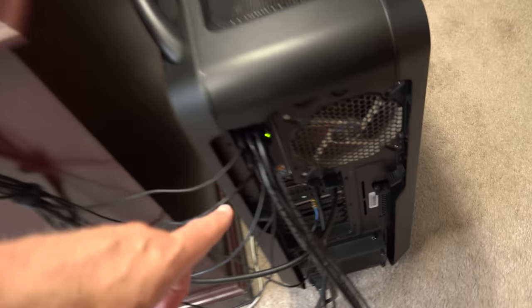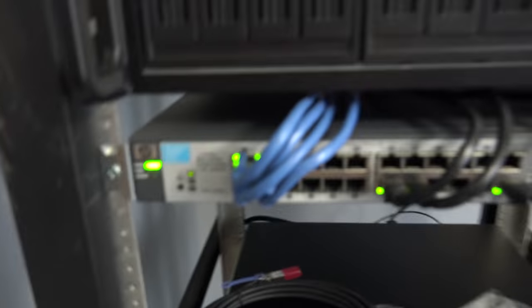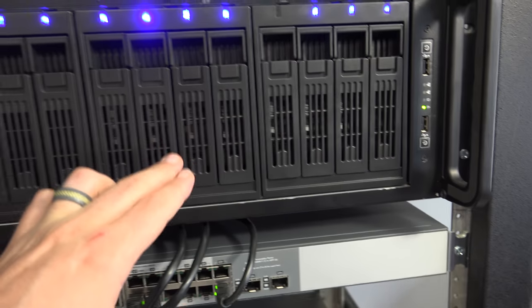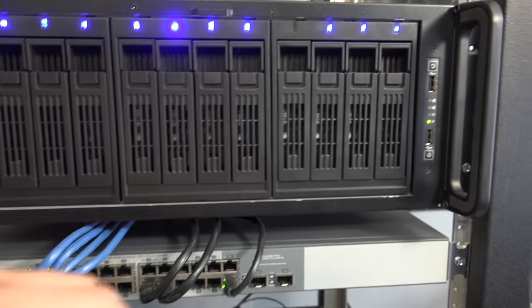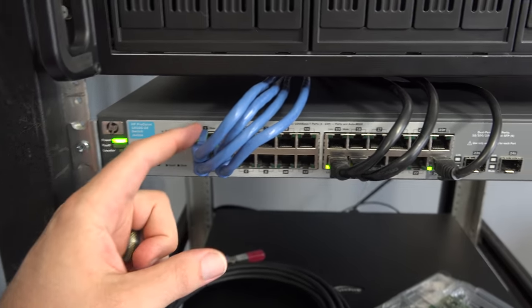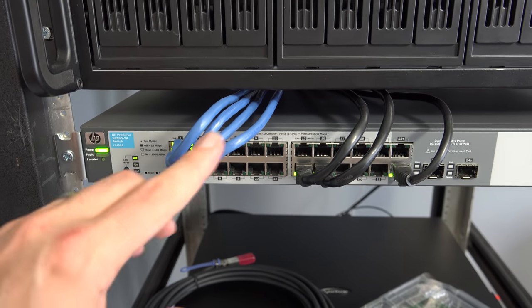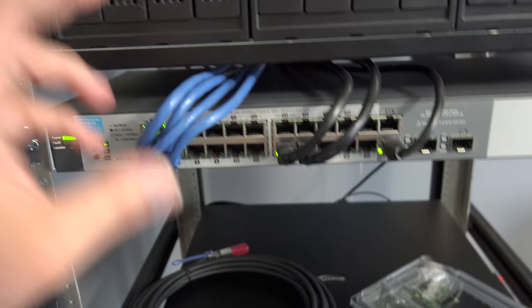my PC here. And I actually only have two of them connected here because I decided not to install the second NIC that I bought that had the 4 ports, because I found out that it was an unsupported feature with that NIC. That was not allowing me to combine the bandwidth on all of these. So pretty much that was kind of a waste. All it did was give it some balancing or some backup.